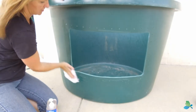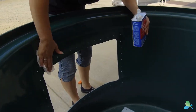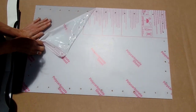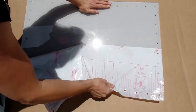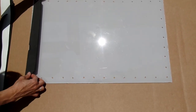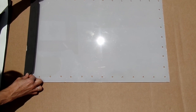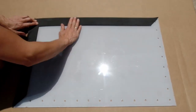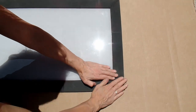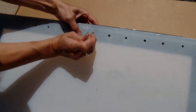Setting your window. Step 15. Wipe the outside and inside of the window opening with denatured alcohol, and remove any remaining Sharpie marks as well as prepare the plastic surface for the neoprene gasket. Step 16. Place the window on a protective towel or cardboard. Peel the protective film off the outside-facing side of the window — use your fingers to avoid scratching the acrylic, and be careful not to cut your hand on the sharp edge. Step 17. Locate the four pieces of neoprene — two short pieces and two long pieces. Peel the backing off each piece. Align the back edge and corners, then carefully apply to each straight edge, avoiding ridges or bubbles. Make sure the neoprene is adhered fully to the window and that the corners are aligned well and won't allow any leaks.